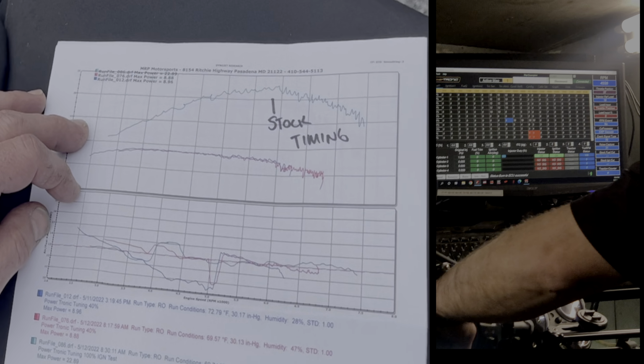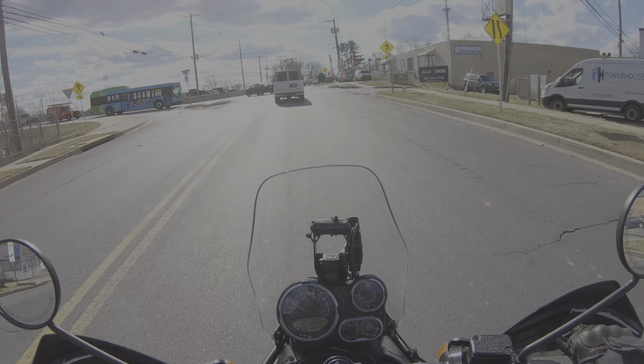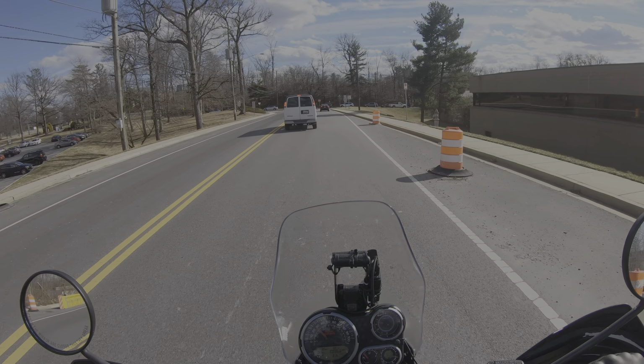So say I was at 13% and at 4,500 RPM, and there was a data point there. The program might have that data point highlighted, plus the throttle percentage above it. Say if we were doing 16 at 4,500, it would be 20 at 4,500. And then it would have 20 at 5,000 highlighted, and 16 at 5,000. So those 4, and if you looked at whatever it said it was delivering, it wouldn't match that one cell where you had the bike at. You know what I mean? So you had to play around with it. That's why it took so long on this one.